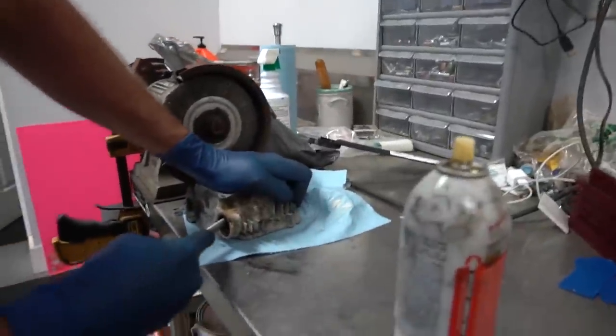Good morning guys. Ike has already started hitting the head with the file. The intake and exhaust ports are tapered - they're big at the ends and they get skinnier as we go in. The main thing we need to do is open up that bottleneck where it tapers at the end, and we really can't do that with the Dremel. So we don't want to lose all of that taper, but we want to open it up just a tad.